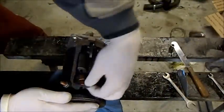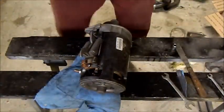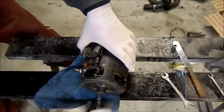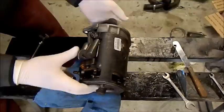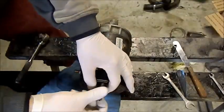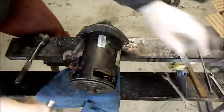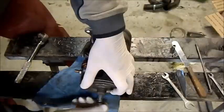They're very easy to pull apart. There's a gasket. I just want to show you there are a couple of do's and don'ts with these, and I've made the mistake of doing this with some starters I've disassembled. There's the clapper mechanism that throws the bendix out and there's a little sort of switch under there which you can keep clean. I'm just going to take these off and take the end cap off. I have no interest in using this so I can just bin it.